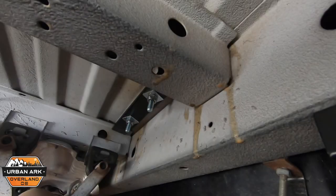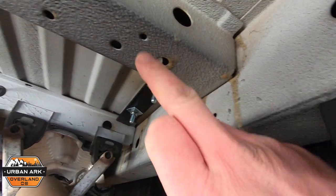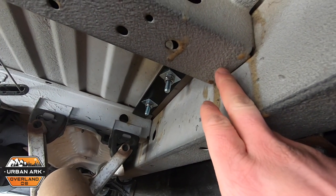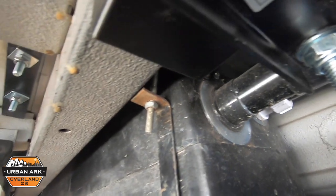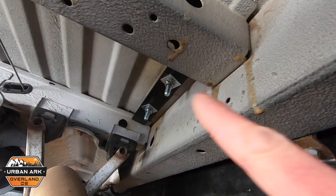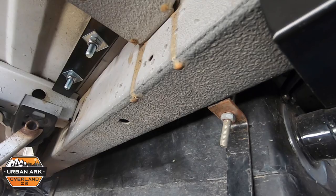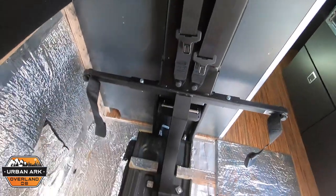On the front section I've used a big piece of metal bar to brace from chassis rail to chassis rail — that's way over-engineered compared to what they suggest. I think where they would like you to fit this, if starting from scratch, is actually crossways through one rail meeting the other. I couldn't do that because my build is already under progression. Putting it where I've put it — a little bit further back — I just about miss all of my water tanks. If you do put it through where A meets B, you may get interference with a water tank if you've got one sitting under the driver's side.